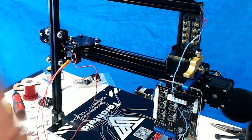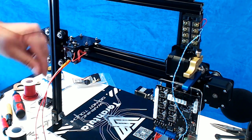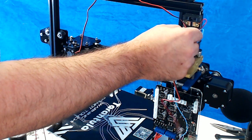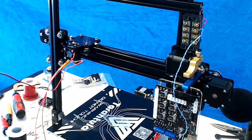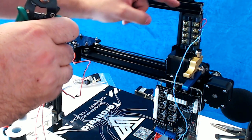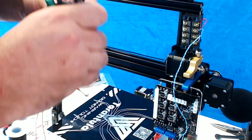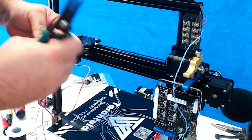This is my extra 12 volt coming up here, so I can take my fan wire and wire it right into here rather than bringing it all the way down and around, since this needs to be on all the time. If you don't have this terminal block, go ahead and bring it all the way down and around — you want to attach it to the all-time-on 12 volt, and not to the fan section.